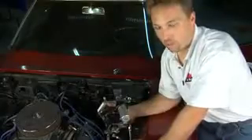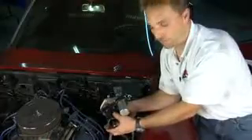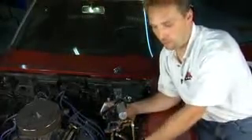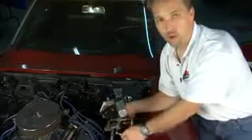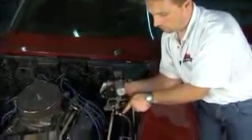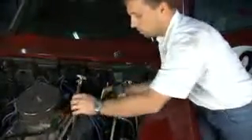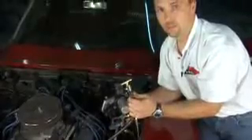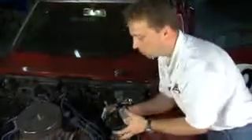This car is also equipped with a rack and pinion assembly. Whether it has a rack and pinion or a regular power steering system, you're still going to connect the hose into the power steering assembly. The main power steering pressure line will come from the power steering pump into the HydroBoost assembly, then go out of the HydroBoost and down to your hydraulic ram or rack and pinion. You also have a return line — a low-pressure line that comes out of the HydroBoost and goes down to the return line on your steering. It comes with a three-way fitting that ties the return lines together back to the pump.